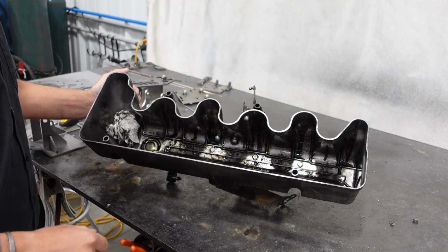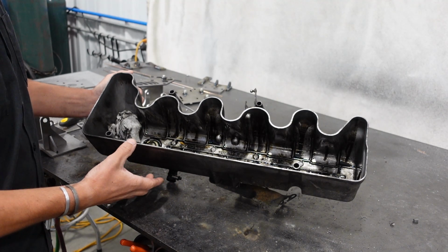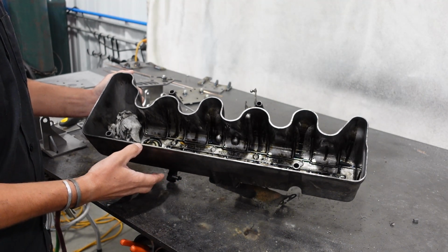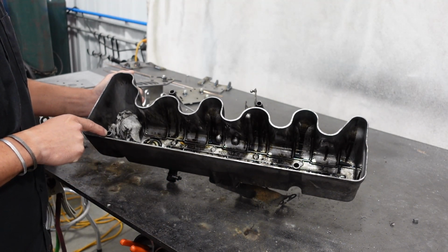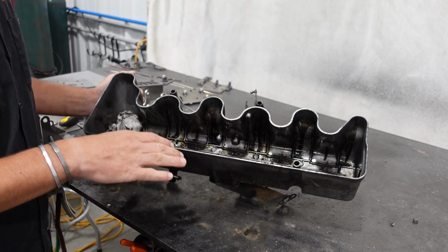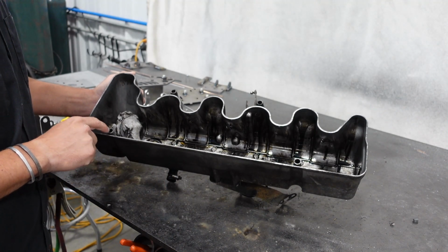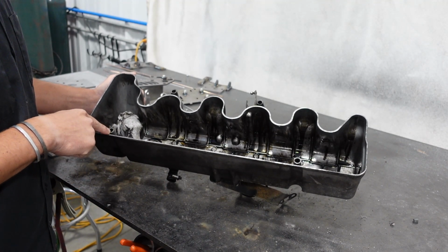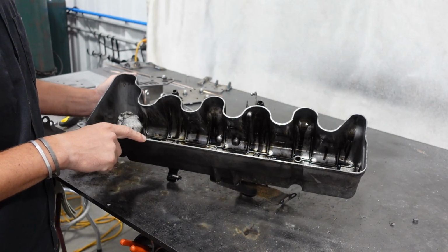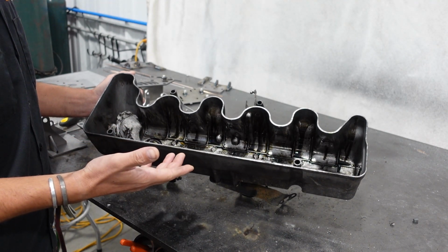So what actually generally causes these valve covers to leak is that people might over tighten these, and what that does is it'll actually cause these mounting feet to contact the head, or to contact, it's actually part of the stud, but where these seat, it'll actually touch those before the valve cover can crush into the gasket. So it's a real simple fix.